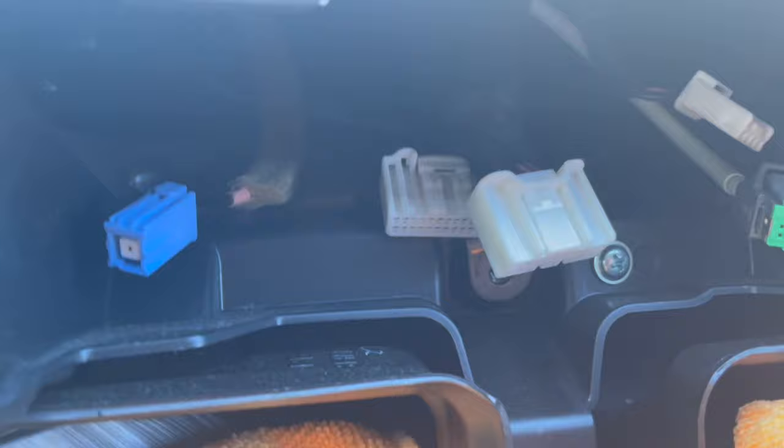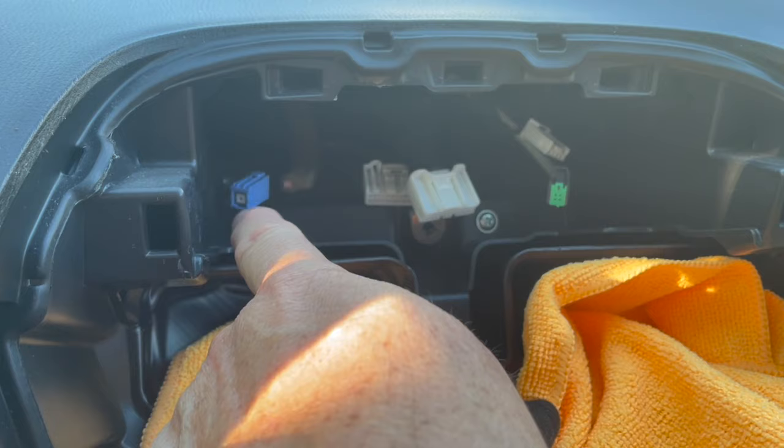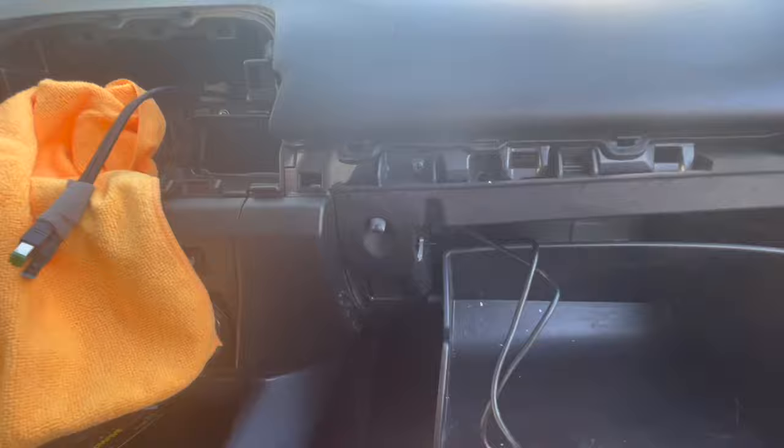You're not going to wind up putting that green cord back in. That blue cord is the one that's going to be a pain, but once you get it in it works fine. The clips are located on top of the connectors, and that's on all the connectors in the vehicle. It works to have a fingernail on your thumb — they seem to come out easy.